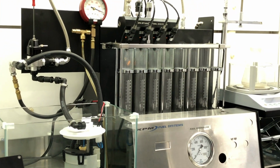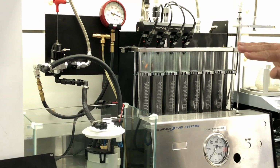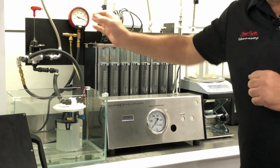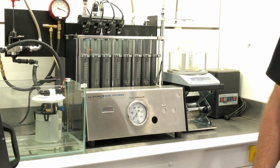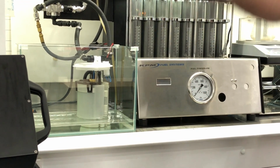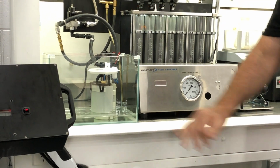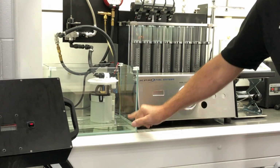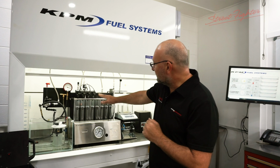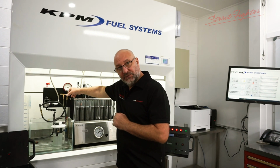Okay, now you can see that system running as you would down a quarter-mile strip, 700 horsepower, injectors flat out, 30 pound of boost. Have a look at your fuel module. Absolutely full. Take your first corner on your local track. Your fuel tank's near empty. Your module's absolutely full, meaning no surge. Flat out from the injectors, supplying all that fuel at 30 pound of boost.